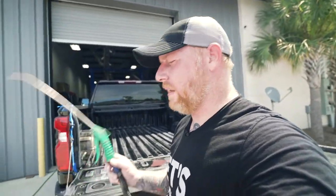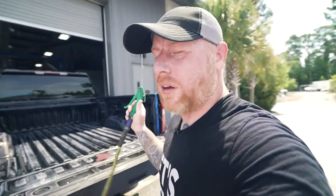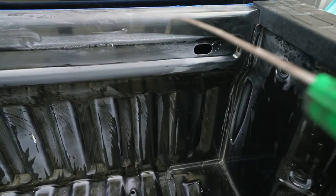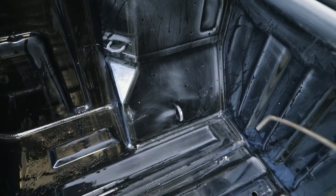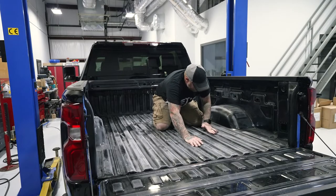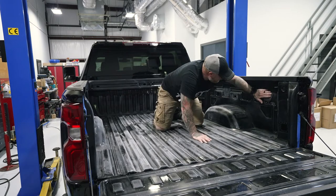You're going to need a compressor to spray the bed liner, so hopefully you've got an air blower and enough volume of air. I'm going to blow all this water out, try to dry it up a little bit, and then pull it inside the shop to finish taping and start spraying. Using an air blower is good for two things: it helps dry up the water faster, but more importantly it ensures you get all the water out of the little cracks and crevices, avoiding any water contamination when you go to spray the bed liner.